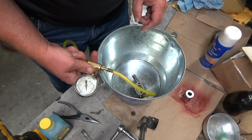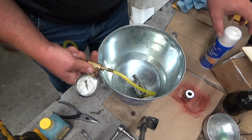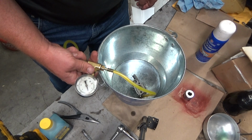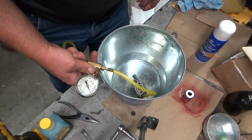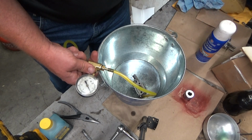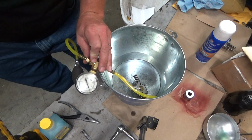So initially, nah, it's about the same. So I guess you can get the same results. Soak your gaskets for a couple hours, or blast them with a little Permatex. Either way, Ed will go through the other side and hook the inlet diaphragms back up, dry these out, and get them heading back your way.